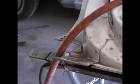Hey everybody. Well, man, here's where we're at. This is the best door I got on this car, and it's a mess. Had a little hole here I patched up. Worked a long time on pinholes, getting them welded up. I'll use this piece of copper pipe to go over my pinhole, then weld from the other side, and it would end up nice and smooth, and all the globbiness was inside the door that way. Just a little bit of stuff, I could grind it down, and it seems to be a heat sink there and stop from blowing through.